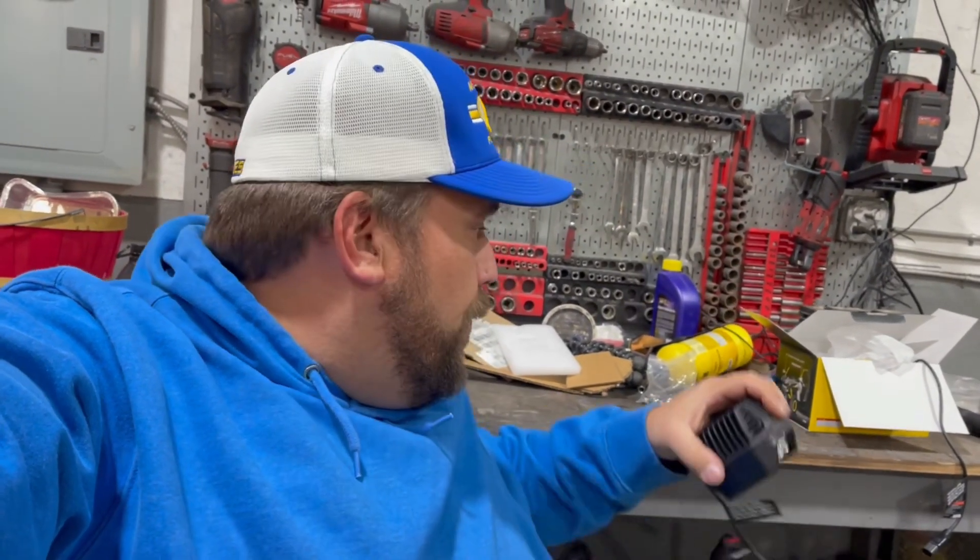These light pods have LEDs on the sides so I'll get a little bit of illumination off the side of the buggy. I had to fabricate the buckets and everything for those in the bumper. I also added a piece to the front to help strengthen it where we're going to have the D-rings bolted to it. The fair lead doesn't exactly fit where I had it figured on the truck, so I had to make a couple of changes, but I think a half-inch of steel will be more than enough to hold that fair lead in place.